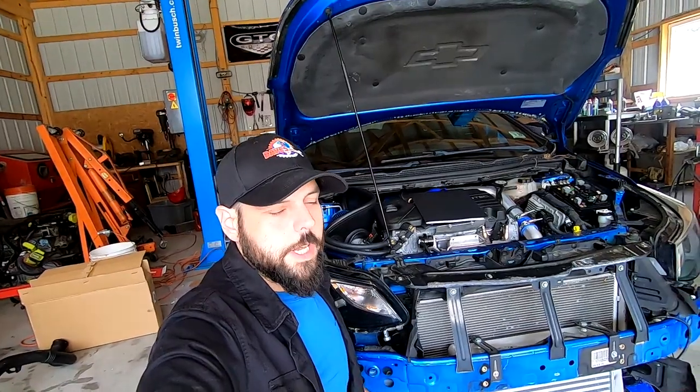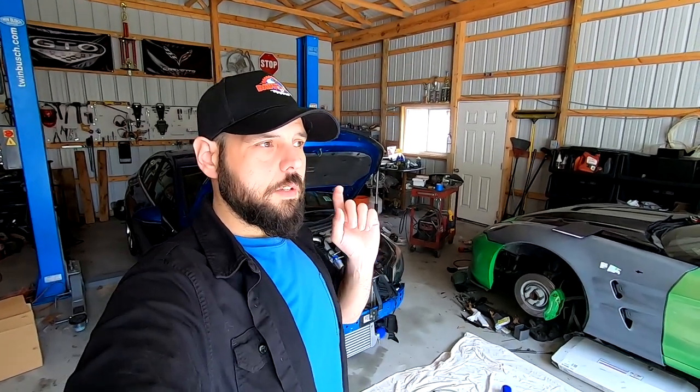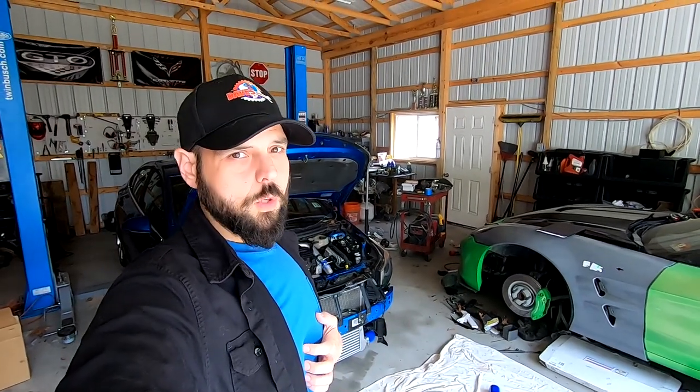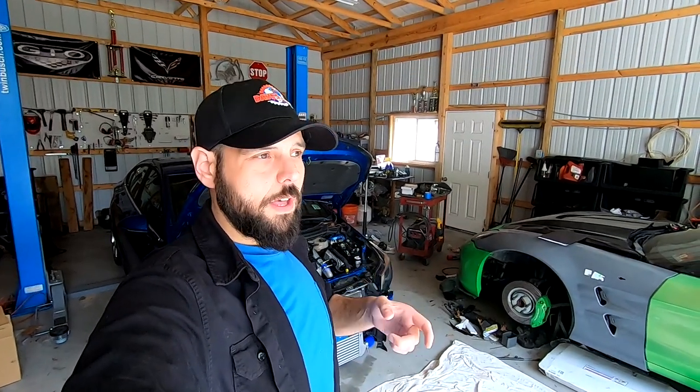Welcome everybody to the Dave's World YouTube channel. This video is going to mark basically a two-year anniversary of one of my first videos — how to install a boost gauge in a second generation Cruze. For starters, we're doing a very simple modification to get a boost and vacuum reference off of the engine. Yes, it's reversible — the hose is like a dollar at the auto parts store, so why wouldn't it be?